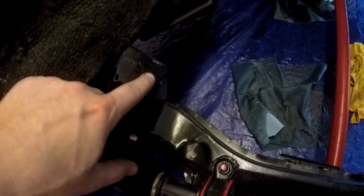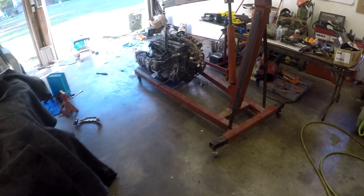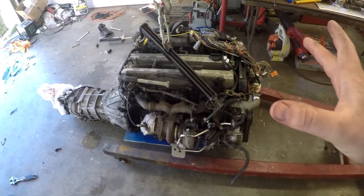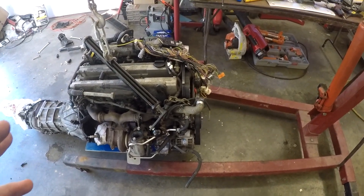It's a little bit later. I actually went ahead and pulled the motor back out of the car. I was having a little bit of trouble getting it to fit perfectly — I just couldn't get both motor mount bolts in there. It could be because I have them on the wrong side, or I might need to connect these two holes here to lower the motor down. I pulled the motor back out and I'm going to take all the stuff on the sides of the motor off, and probably the transmission, just to make it a lot easier. I'll test fit it with all that stuff off.